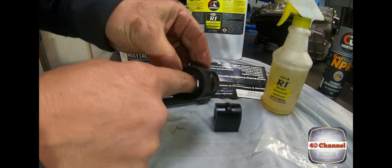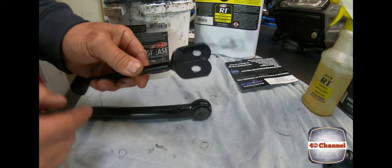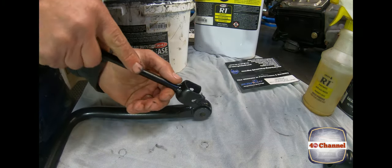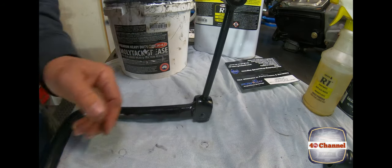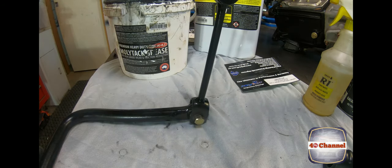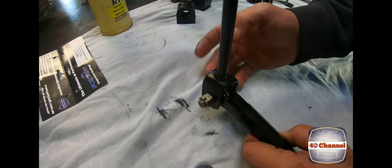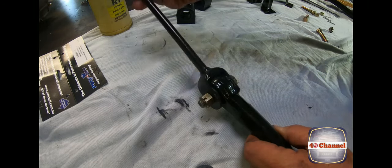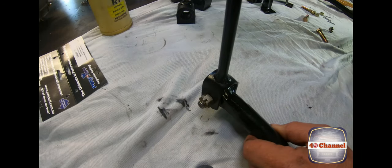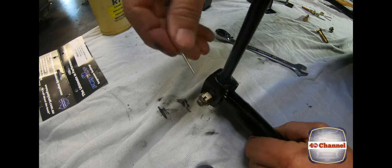Put a little bit of grease on the inside of that bush, and grease the outside and inside of our connecting points. You've got a little retainer lug just on one side — put that on the inside and slide it straight over, so our new bolt slides straight through there. Spin it so it catches on that little retainer and put our nut on the other side. We're not doing these up tight at all because we don't want to crush any of that — we want full free movement the whole time. Just do it up firm so the back of the bolt pulls in. Make sure we've got full movement, then once you're in a good position, get our split pin.